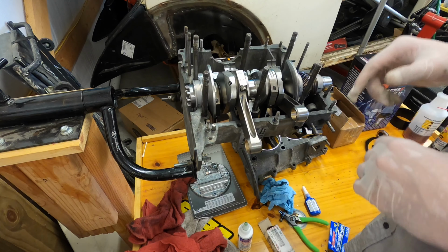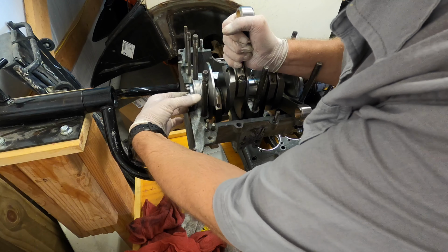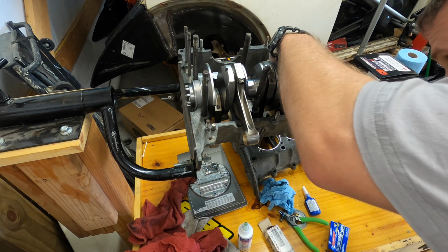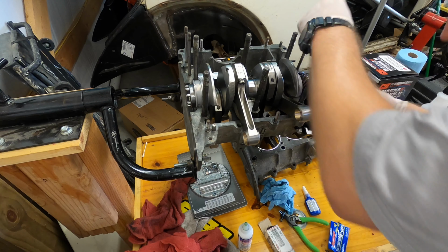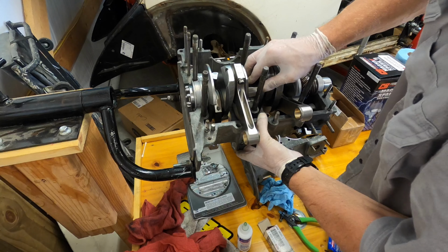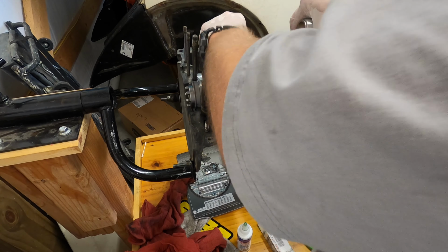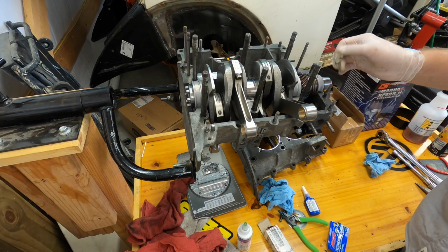Because, like I said, you want to make sure that these are properly aligned with the dowel hole. So I've marked the bearings. It should be right about there. There and right about there. All right, so it should be seated. Should rotate pretty freely. Assembly fluid's kind of sticky. So it's sitting down. Just make sure you look underneath. It's sitting down.